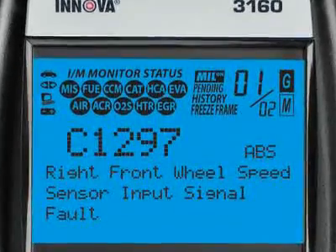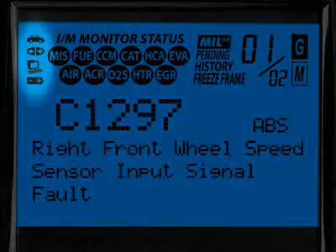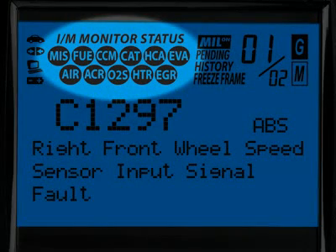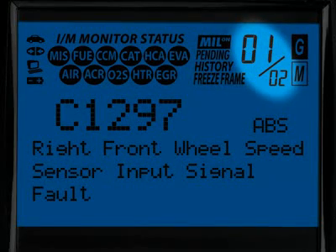Our patented all-in-one backlit screen shows over 20 pieces of vital information at any one time. The icons circled here show the battery power and whether the tool is communicating properly with either the vehicle or PC. Highlighted here are the emission monitors icons found on your vehicle — all Innova tools run a test of them to see if they are complete and functioning properly. These four icons show the status of the malfunction indicator lamp or MIL status, if there are any pending codes, the code history and the freeze frame data. The numbers highlighted here show you how many diagnostic trouble codes you have and the order in which they were set by importance.